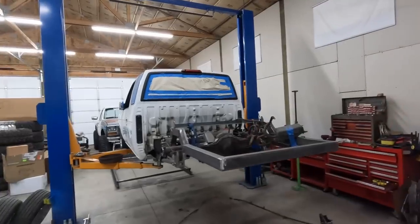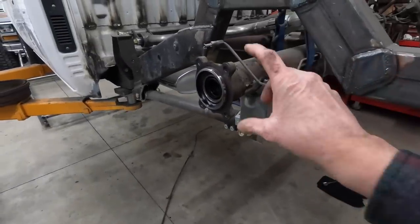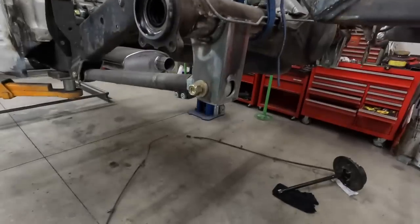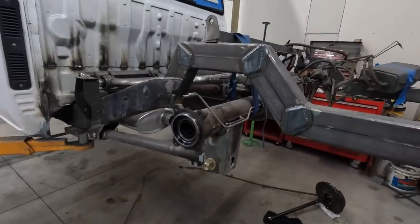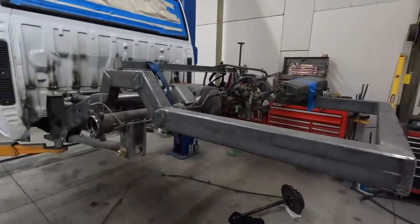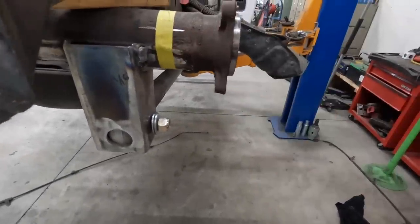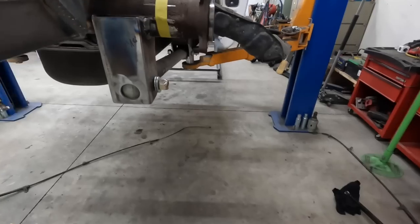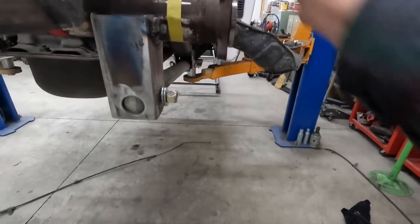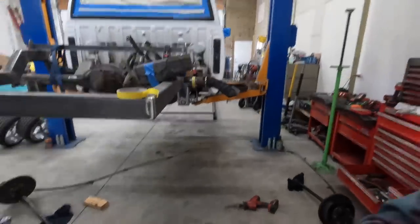The goal is I cut that, and then cut that, and then bolt this yoke back on, slide everything in, and use the axle shaft itself to sort of realign it — then tack weld, finish weld, and have a pretty simple narrowed rear end. I'm going to cut on the tape mark, cut on this side so I can take the chunk off, go over to the bench, and cut the other side exactly where I want it. Time to start chopping.